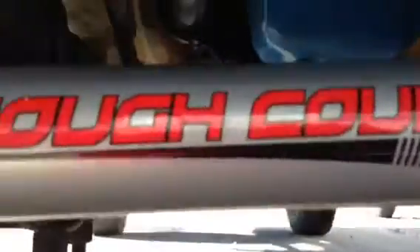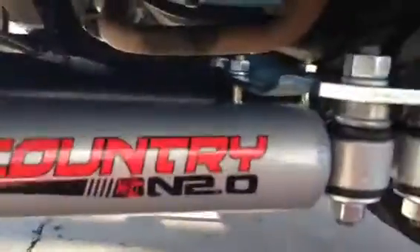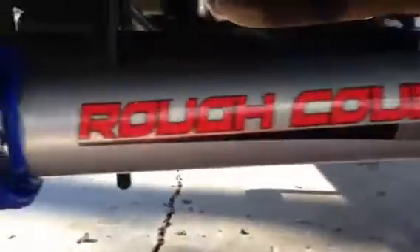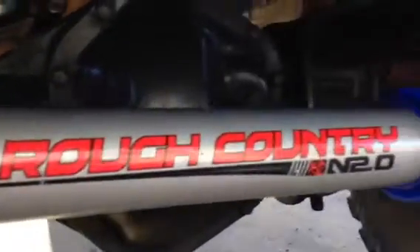Let's get a little closer here. Right underneath there you can see there's a strap that went across, and that's what the old stabilizer was on, and then it connected over here. This kit is basically for any Dana 44 or GM 10 bolt. Basically all I'm seeing on the install videos on YouTube is for Jeeps and stuff like that, but it's real simple.